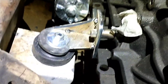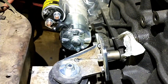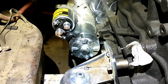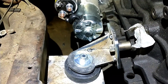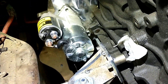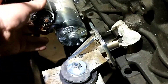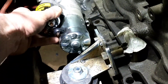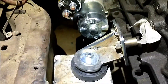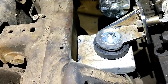I may still run a gusset on this side since it's sticking out pretty far. On the other side the bolt holes are all different depths, so you end up having to put some pipe in there and get it all the right length — you'll have at least an hour's worth of time making these mounts on the engine side, and for me that's almost worth a hundred dollars. Specifically for this Chevy I had to bring it forward as much as I could so the starter can still slide out — it just barely misses. If I came straight out I would have locked the starter in there for good.